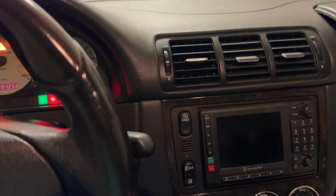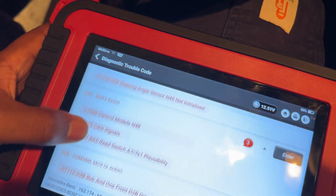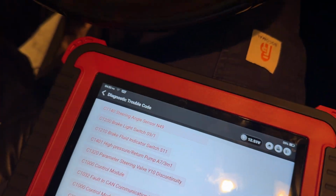So the 16355 has been giving me quite a lot of problems. I took it home from work yesterday, and I was greeted with the car not leaving second gear, which is very typical of the 722.6 when there's a conductor plate issue. Now, mind you, I did change out the electrical connector a couple of days ago when I did the transmission fluid change with the new filter. So I'm wondering if those are related. I'll be checking it out.